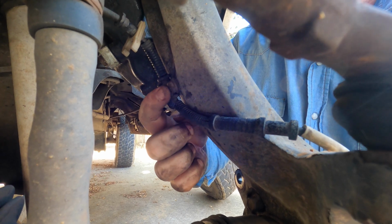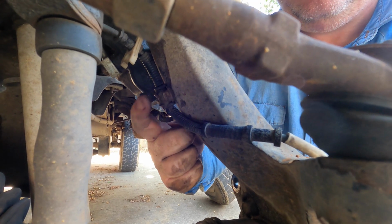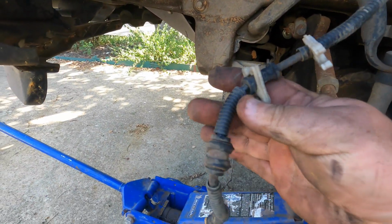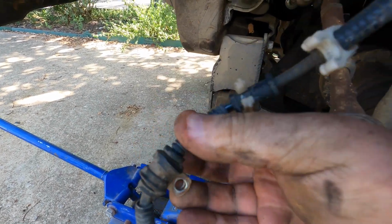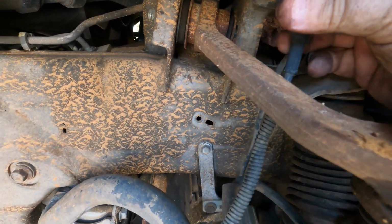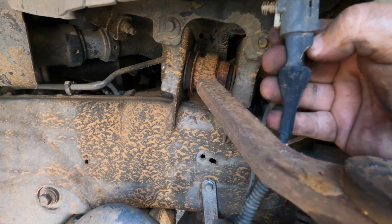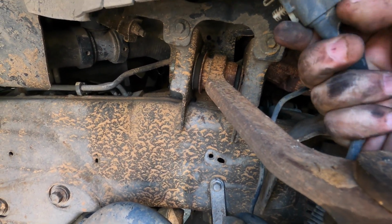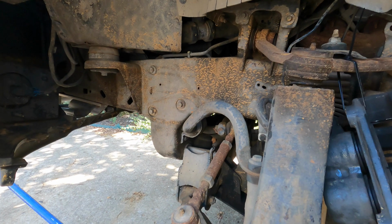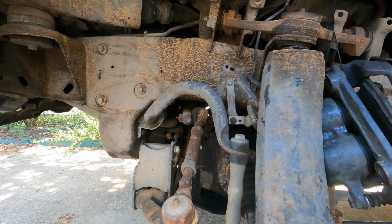Okay, so this nut here on the back is actually an 11 millimeter. So if you're one of those folks who's always losing your 10 millimeter wrench, you'll be okay here because it's 11. All right, so once we remove that little 11 millimeter bolt holding this bracket, a couple of clips, I had a zip tie holding it here, just tying it up, and we've exposed the plug, and basically we're just gonna separate that. Of course, one-handed, it's a little bit of a challenge, but hey, we got it. And that's all there is to removing it. Now we're gonna get the new one and plug it in and basically reroute it the same way we took that off.